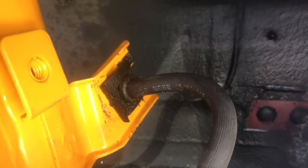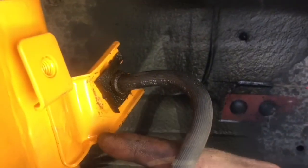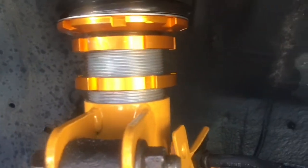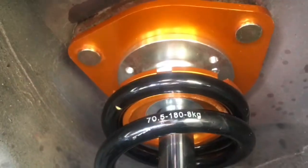Alright, so I just mounted down here. There's the brake thingy. You just slip it out and slip it back in this groove that's in here. Bolt 17 mil, easy. I put the nuts facing forward, because I don't know, that's kind of how it is. I still need to set up the height and the preload and tighten the 14 mils on top.